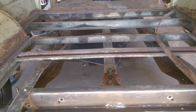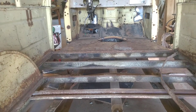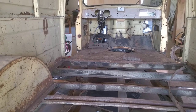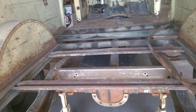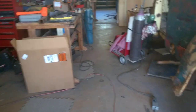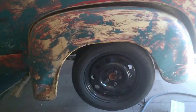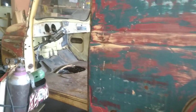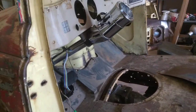You're looking right there at the drive shaft, which ironically is a perfect fit for this truck. If this is basically a short bed, you'd be at 112 inches. The only thing we've done is move the axle back an inch and a half to get better placement in the wheel, and that left us about an inch and a half off on the drive shaft. If it were in the original position it would actually be quite perfect.